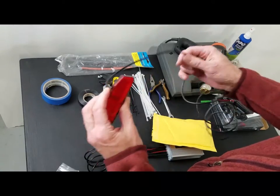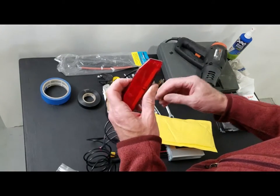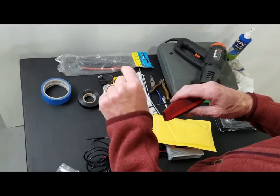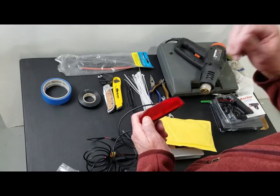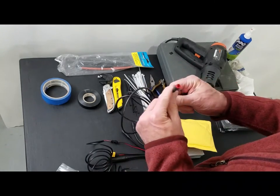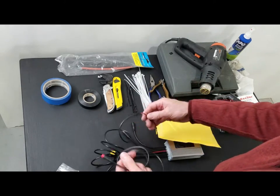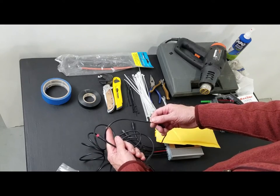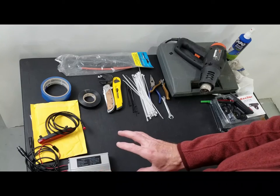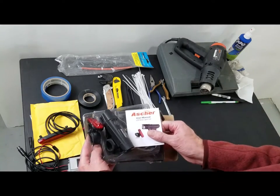The pros of having this type of system and wiring it in like we're talking about, I'm going to be able to turn it on and off with my thumb pad, right? Same time I turn that headlamp on, bam, taillight's gonna go on. The con is I'm gonna have to snip off this line, this end, and solder it into this end on the bike itself.